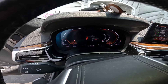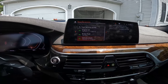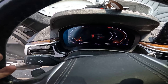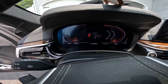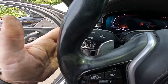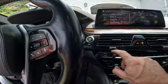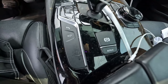How to reset the rear brakes when the light hasn't tripped yet: looking at the messages — engine oil, brake fluid, vehicle check — they all say okay, but there's no selection for brakes. If you press and hold the BC button to bring up messages, a brake reset won't come up. There's really no way to reset it unless the brake pad sensor has worn through, so you actually have to use a scan tool to reset the date, or wait for the warning to come on.